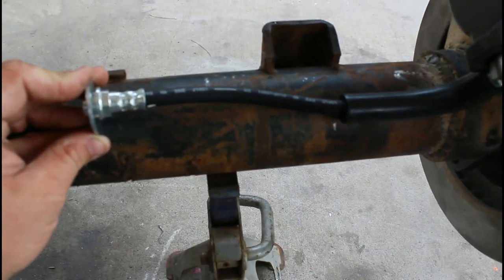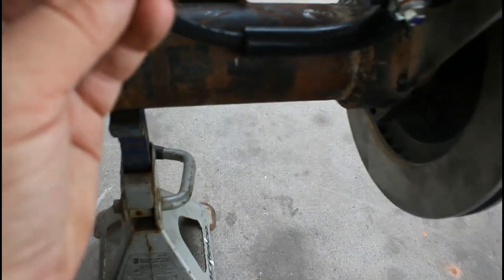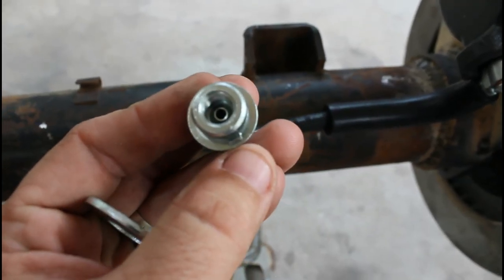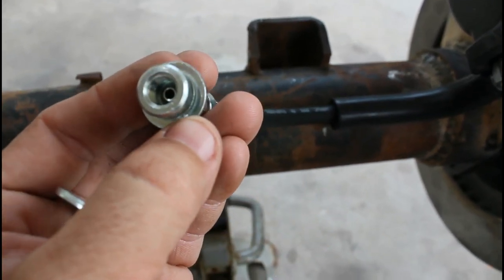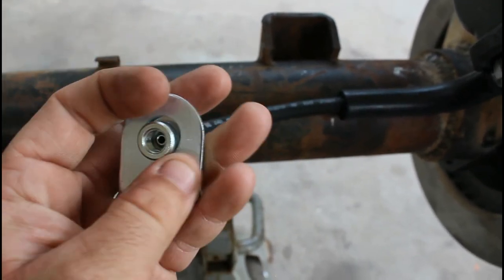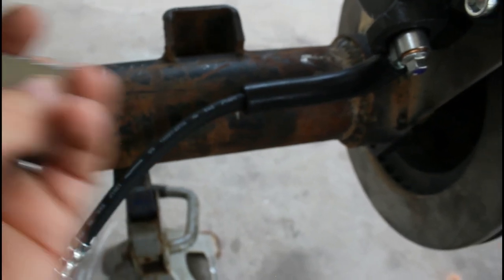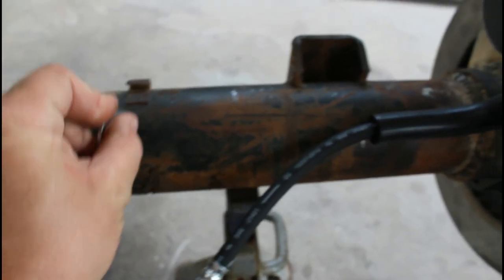I want to push my line back because I want a little bit of play in there. Now keep in mind — if you look at these, you see this little notch right here? It has one here and one up here. You have to go in with a file or grinder and file this down, then this will slide over and you put the clips in. Before I do that, I'll grind a little radius out so it fits well on the axle — because flat doesn't fit around a round surface.